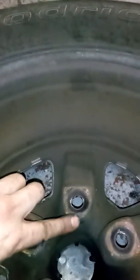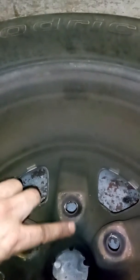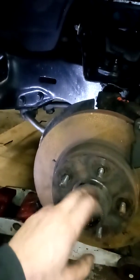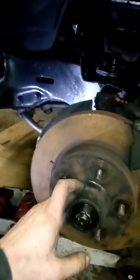The only problem I noticed is my rims — the Cutlass rims on the back did it too. The way they're designed, they hit right here on the hub, on the back side of them. This part right here was hitting the center hub, so it's still not big enough there. Maybe putting a spacer in and having them re-drilled or something might do it.